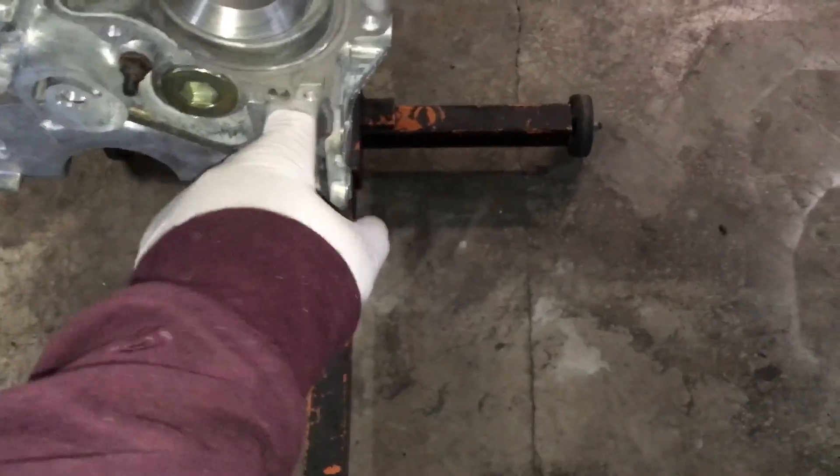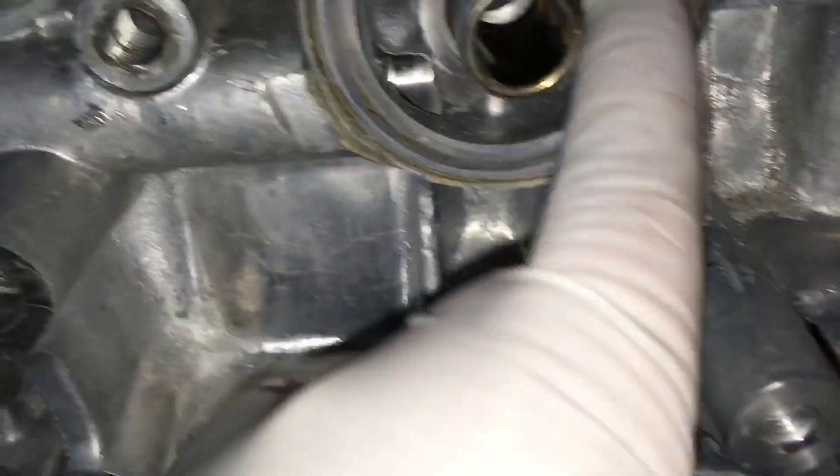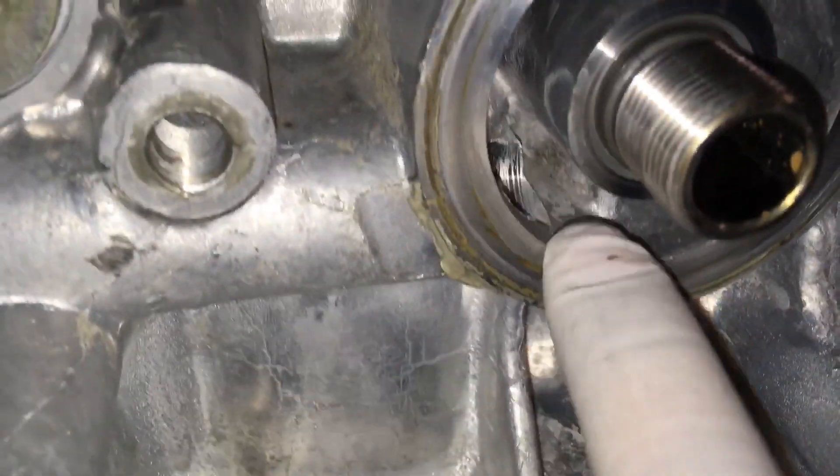What I told him to do is drill it in a little bit so it could be smoothed out — just drill it a little bit bigger. What I'm gonna do is get in there and actually make it smoother so the oil passageway will be super smooth. So when VTEC hits — you see how it has a dip right there — I'm gonna follow that down.